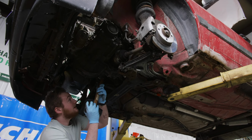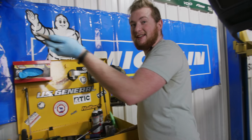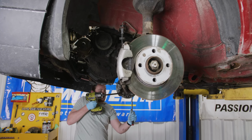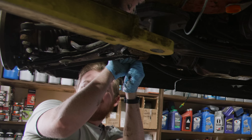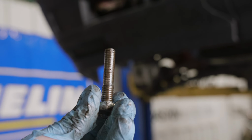Yeah, one bolt is still slightly in. Now, working on cars is essentially a game of just moving things out of the way. The reason I say that is because in this case, I'm trying to get to the transmission. And in order to get there, we have to move the CV axles. And in order to move those, we have to move the control arms. I don't know what happened to this bolt, but...